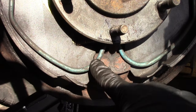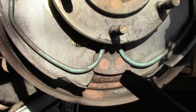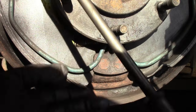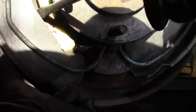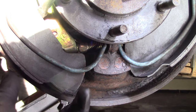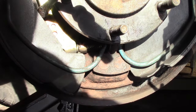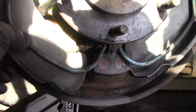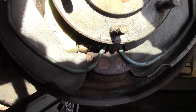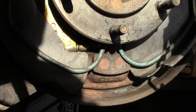That is the ticket, that is the path forward that I'm taking, and we'll see if that works. So to make this a lot easier, I'm going to take my grandfather's 100-year-old screwdriver, been through a war or two, pull it on the shoe and stick it right there. That will hold my shoe in an outward position, thereby exposing this rubbing surface that I need to apply grease to, and exposing the surface in there, which is the other area that I need to apply grease to. So as long as my screwdriver stays there, everything will be okay.